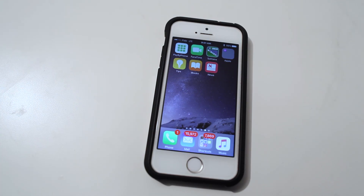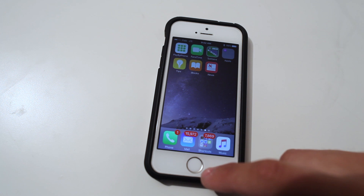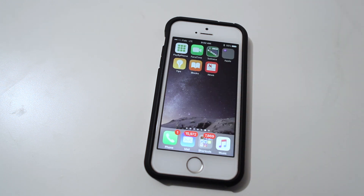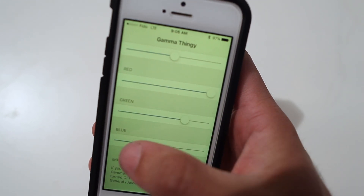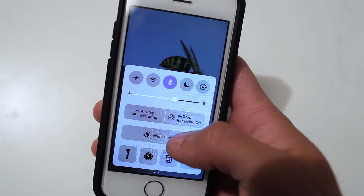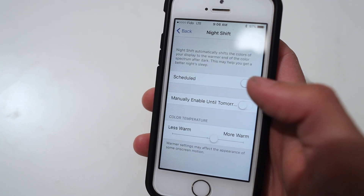Cell phones can be dealt with similar to an LCD screen. Depending on the model of phone, you may find that you can adjust your backlight without introducing flicker, although some cell phones may not be as cooperative. On iPhones, you can use the Night Shift feature to color correct the phone's display. If you have a Mac with Xcode, you can also download the source code for an open source app called Gamma Thingy and compile it onto your phone, which will give you much more control over your iPhone's color settings. On Android, there are many free apps available which will allow you to adjust the color of your phone. Links to Gamma Thingy, CRU, and Flux can be found in the description of this video.